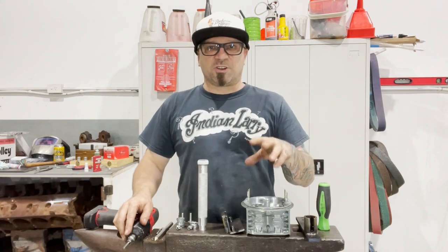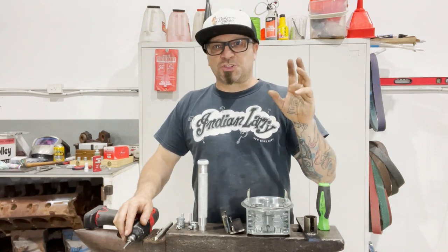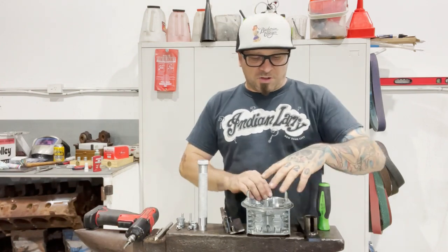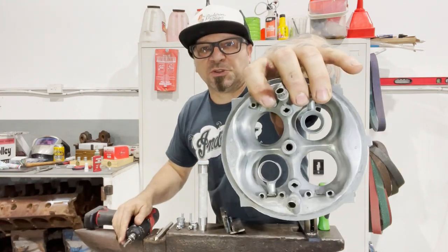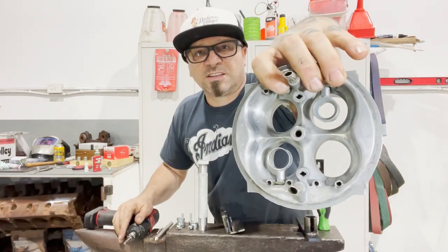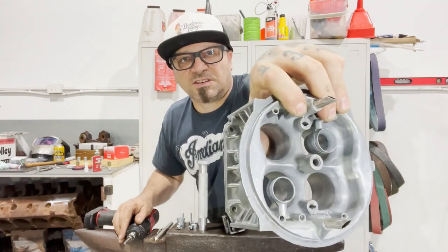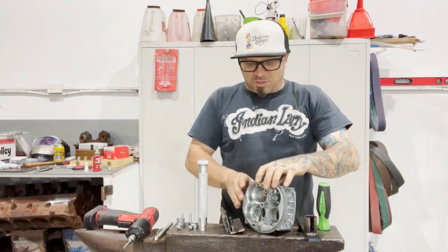I had a long think about how to make this user-friendly. So instead of boring you with the full construction, I'll show you how we can install the booster. What we've got is a 4150 body, and in there you'll see we have two legs missing — or banjos. The bottom right has just the banjo on its own, and the top left has the actual annular booster with the banjo.